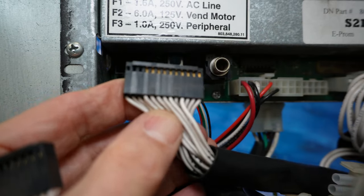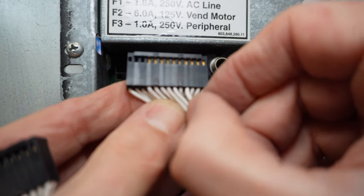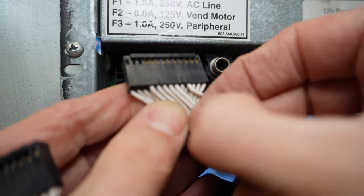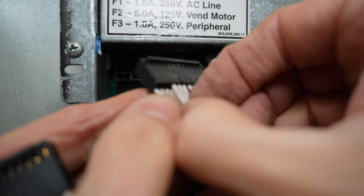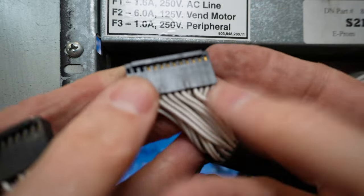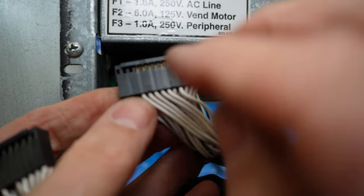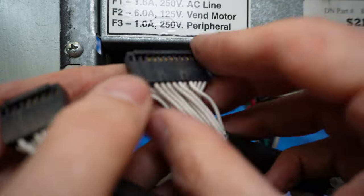Now what I'll do here, just like I did at the bottom of the door, is pull back on each individual wire to make sure the pins do not pull out of the harness or connection. It is a bit of a painstaking process, but when you're down to this point, it's worthwhile to spend that extra time to see if that's where your issue is.